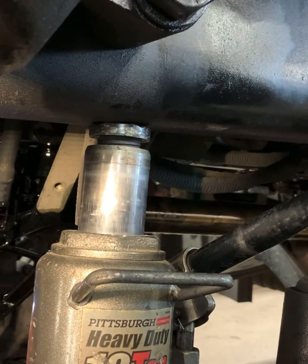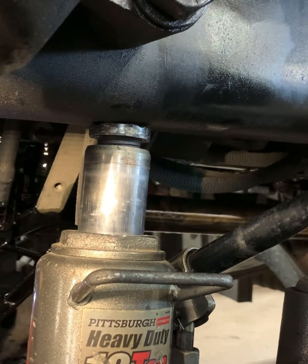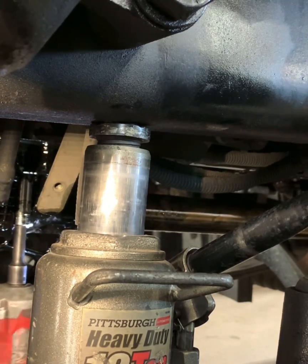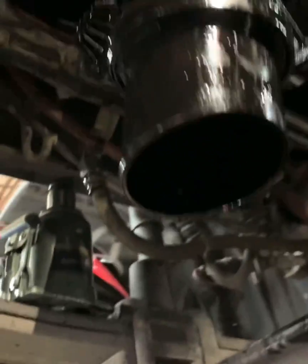There's a nice light. Cool, we have a good start. Now we're going to put that sucker down and give it the magic touch. Double check that screen. Double check the O-rings are sticking out from those tubes and then we'll be pretty good. If you saw my other video, you already know — we're going to clean up the sealing area and slap that oil pan right back up. What do you think? Doesn't look so bad, right? It was never fun to do — leave it to the grease monkey. Hope you guys learned something, tap that like and subscribe.